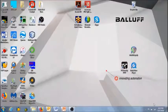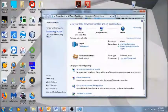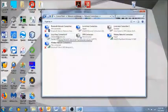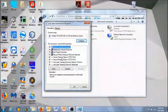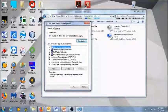The easiest way to do this is to go to the bottom right side of your screen, right-click on your Network Adapter icon, click on Open Network and Sharing Center, then click on Change Adapter Settings on the left side control panel. Find the number of the connector port you're using, right-click on that, and select Properties. In the Properties window, you'll see Internet Protocol Version 6 and Internet Protocol Version 4. Make sure that both of these boxes are checked, and you should be able to recognize the Smart Camera through the port.